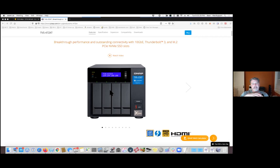So we agreed that two of the drives, it's the RAID 6. So of those four drives, only two, the amount of two put together is the storage capacity. Two of the drives are running as if two could fail, in essence. So he's got 32 terabytes of storage. I put it together here in Orlando and mailed it to him.